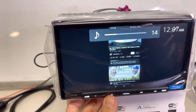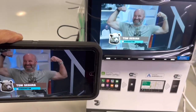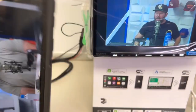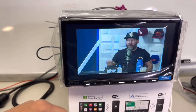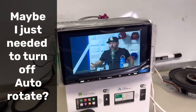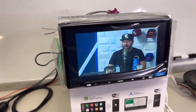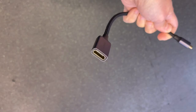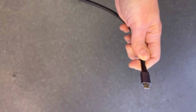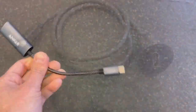So now it's playing and there's audio, but you'll notice the orientation — I had to take the phone and switch the orientation. At one point I was able to get it working properly without switching the orientation. I think orientation is going to be an issue unless it's just a Samsung setting I'm not aware of. But at least there is a way to get that HDMI flush mounted nice and clean using a Ugreen adapter to go micro HDMI male to female, an Install Bay Ethereal HDMI cable, and an Anker USB-C to HDMI.